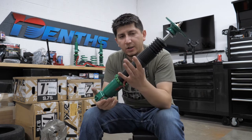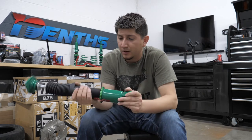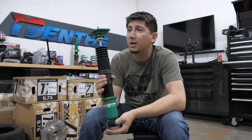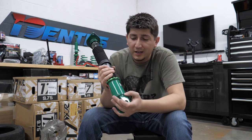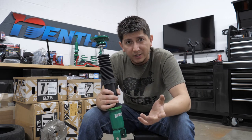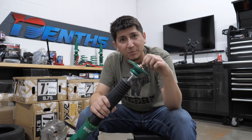Now on to one of my favorite topics: the coilover. This is the rear unit — this car doesn't have what's traditionally referred to as a coilover in the back; it has individual springs. In the front, we have a more traditional coilover setup. The reason I chose the Tein Flex Z's is they're probably the best priced coilover on the market for many applications. Because they're more affordable, they're only single adjustable. But these do adjust both compression and rebound with each click, so you're not just on one spectrum of the shock at one time. On top of that, Tein has a great name and they are rebuildable. When it comes to suspension, I'm a big advocate for spending money on quality parts. Generally when you're done with them, quality parts are still perfectly viable for resale and a lot of people can get the majority of their money back. Something like this is great if you're just getting into the adjustable suspension market — too many knobs can often get people in trouble.